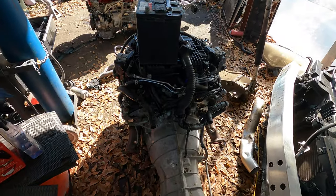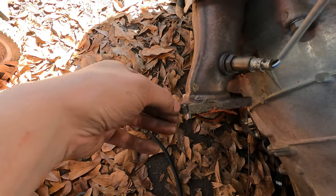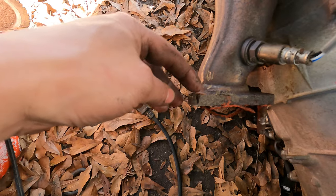I'm kind of going back on the headers now because I forgot these manifolds were all cut up by the previous owner. When they put the test pipes on, they were trying to cut the studs out or something and now they're all chewed up. I'm thinking about backing out of the headers deal because I don't want to put them on and have them start leaking. I might try just bolting the driver's side up, which will be the hardest to get to, and see if I can snake it into the chassis.